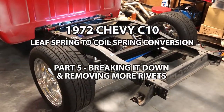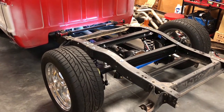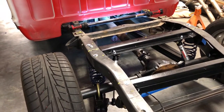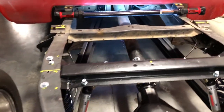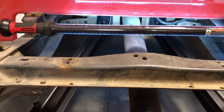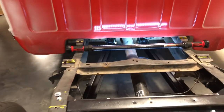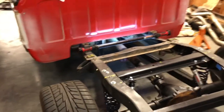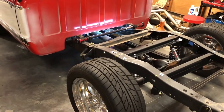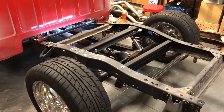Day five, it's back on the ground. It's only temporary, but it does feel good to finally have it back on the ground. I just put it together so I can check on drive shaft clearances on this crossmember here, which is part of the leaf truck and the center crossmember. I'm good to go on this one — pretty tight on the center crossmember, but I think that's due to the motor mount and the trans mount. I got to get it up on the lift and take a peek. Something's just not right up there, but as it sits right now, there's no problem with clearances.